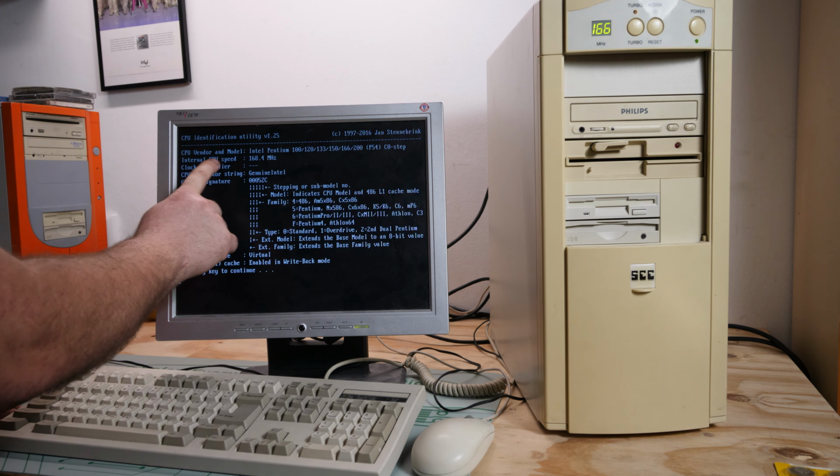This BIOS I really love. It's super simple and it just works. So we have a lot of things to set up, but we don't have to set up that much because the standard configuration is pretty decent. And we have a speed easy CPU setup. So let's go to jumper emulation. And we have a 66 MHz frontside bus. And the CPU multiplier is now on 2x, but that needs to be on 3.5x.